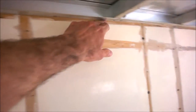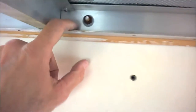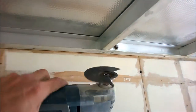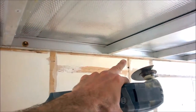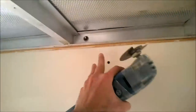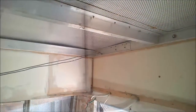Worst case scenario, I might have to cut it across here to weaken it, then remove the pieces left in there, and the new piece will just tuck in about 10mm before it reaches the bolts. So I'm cutting through using the trusty multi-tool, following right on the frame and using the frame as a guide, cutting all along through here. The beauty of it is that's going to give me the curvature profile that I need — all I'll need to do is add 10mm above it so that it tucks in underneath.